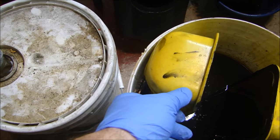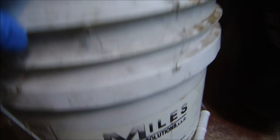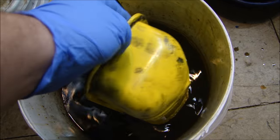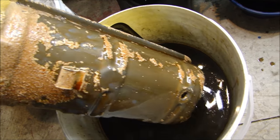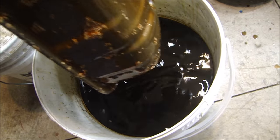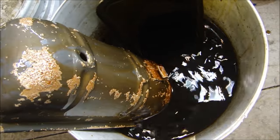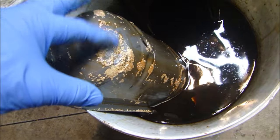The first thing I'm going to do is take these valve covers and clean the paint off of them. There's a chemical I buy from Miles Chemical — Miles Chemical Solutions, LLC, I think they're in Ohio. I buy these five gallons at a time; it's just a paint remover. I pour it in a five-gallon bucket, set the valve cover in there, leave it in overnight, then take it out, shake it a little bit, and you can see how it nicely dissolves the paint. I don't have to worry about using aircraft paint remover, which is very toxic and hazardous. They also sell it for powder coat stripping, so if you have powder coat, they sell chemicals for both. Stuff works awesome.